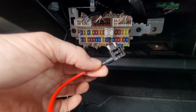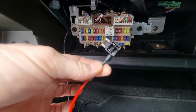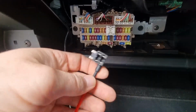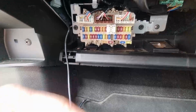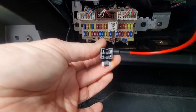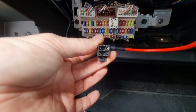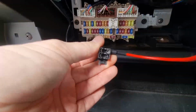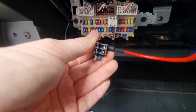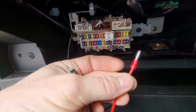Now I'm going to put a link to these in the description. These are the micro ones. They're a couple of quid for like 5 on eBay, but you will need one of them. Then all you're going to do is, when you take the 15 amp fuse out, if you hold it like that, the bottom holder, you would put the 15 amp fuse in, and then the top one where the cable is coming out, which is going to be your add-on circuit, you're going to put a 2 amp fuse for that, for the camera.